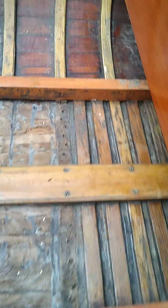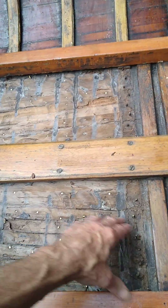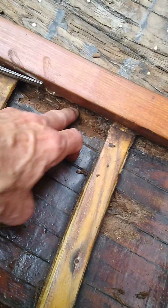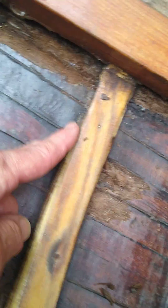Probably put a splint on this cap. Not sure of that yet. And then over top of the mat, probably 2 layers of that. Work in some of these frames. As you can tell, I've got situations right here, and even under these frames I'm going to work in the thickened epoxy because these are kind of hollow underneath.